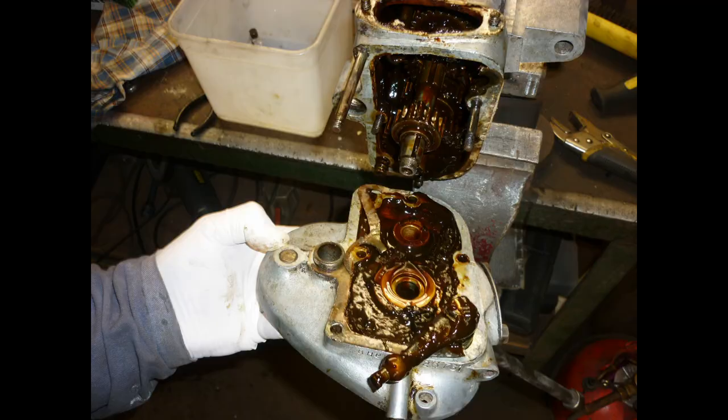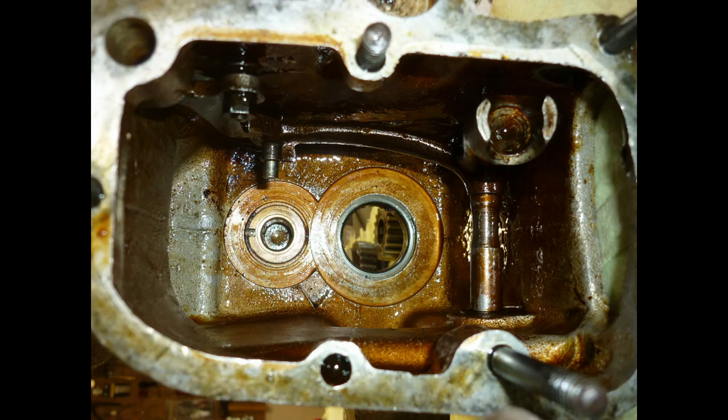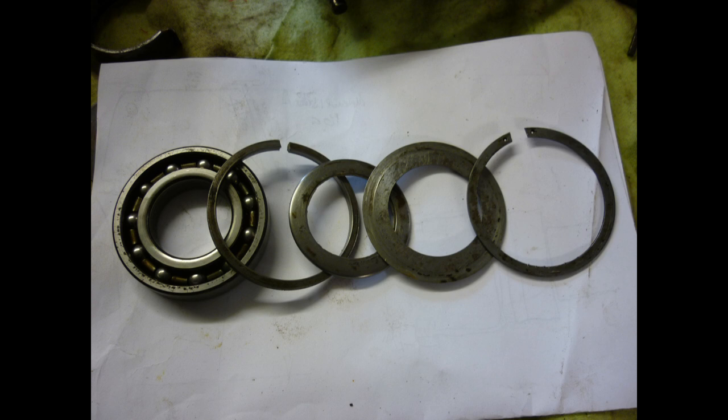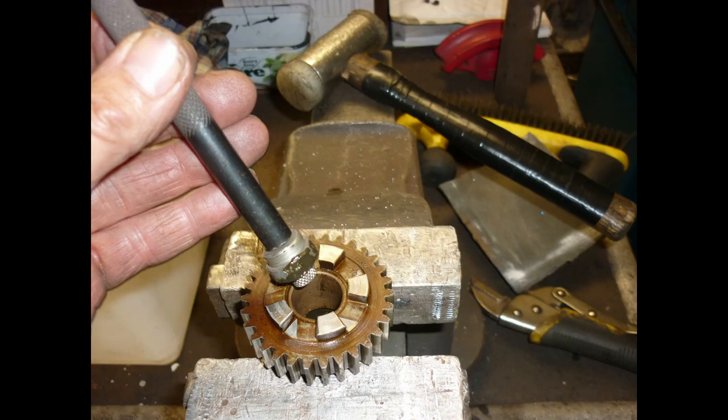It's fascinating to speculate, in the absence of contemporary reports, why this Panther was relieved from service. Rust and borrowed items aside, the major mechanical parts seem intact. It's the Burman gearbox which shows signs of interference, and I wonder what action on the part of an owner might result in the chewed up condition of the gear indicator shaft. This is minus the locating flats for an indicator pointer and the threaded retaining shaft. My verdict: death by Stilson abuse following selector mechanism failure.